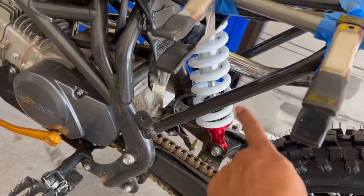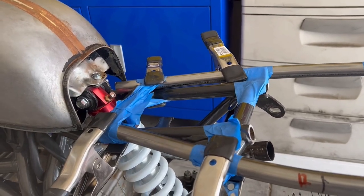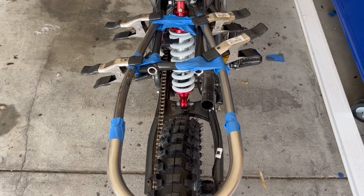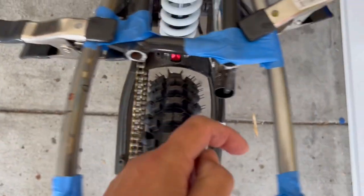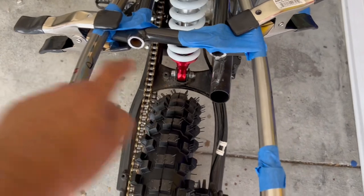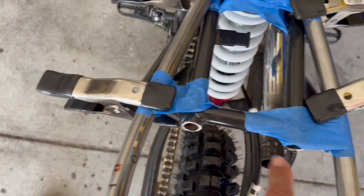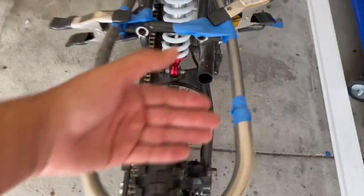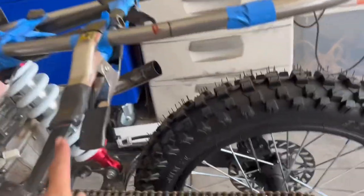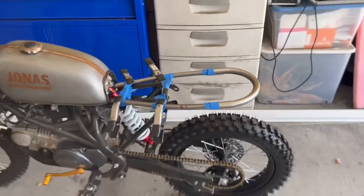I'm taking less risk that my weld for this, let's say, would not work or screw up or what have you. And it's just a smarter way of doing it, regardless. So that's what we're gonna do. We're gonna cut at the mark here and over here, and then get the 3/4 loop, and we'll weld it to here and here, and then we're gonna weld this to here, to here, to here, and to here, and then we will have our seat loop, and I'll connect a bracket going across just for more support. And then I may or may not add another support bracket going from here to there. Haven't decided yet. We'll see how it's working.